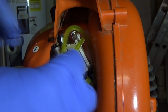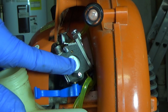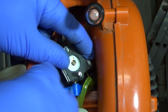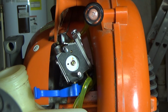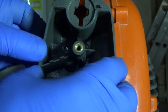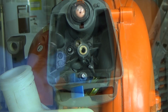So I do have one tip when I was fitting everything in place, and that was the fuel line went behind the carburetor and prevented it from going back in all the way. So that got that oriented correctly, and we'll put the gasket on. Like I said, that hole in that gasket going to the hole where the linkage is connected, that linkage pin, is not really important. So we will get this guy back on here. Make sure it feeds through correctly. There's plenty of fuel line. Again, this just snaps into place. We'll bolt it down.